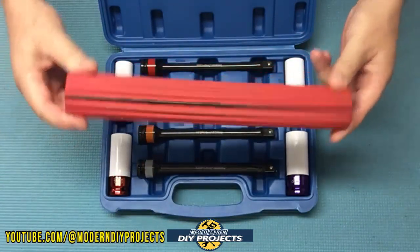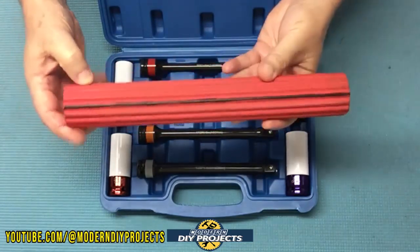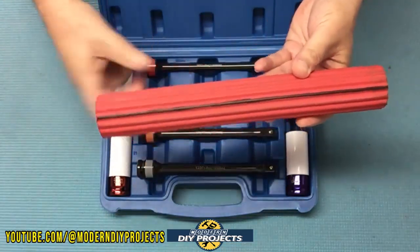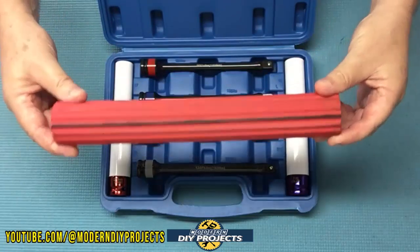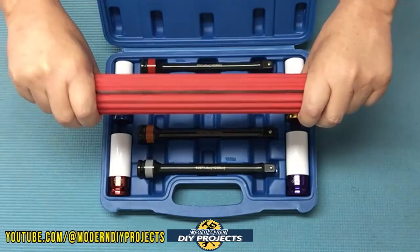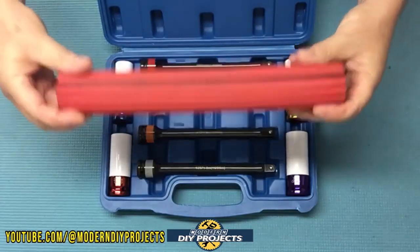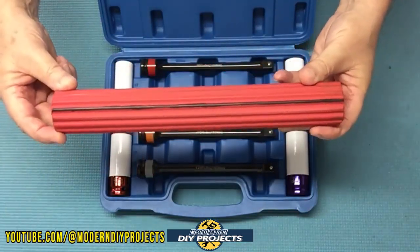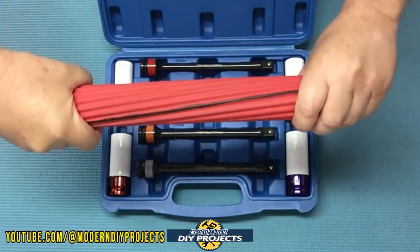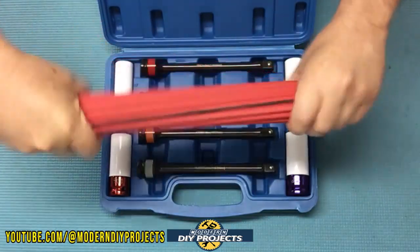This is a little piece of rubber — I found it, I guess it's for yoga or something, but it makes a perfect prop. I put a black line on it to demonstrate how these torque sticks work. Imagine this rubber being one of the torque sticks: on one end you have the lug nut you're tightening, on the other end you have the impact wrench. At rest you have a straight line. When it starts tightening, you get this sort of flexing motion. You can flex it to an extreme and if you go too far you can actually break them.